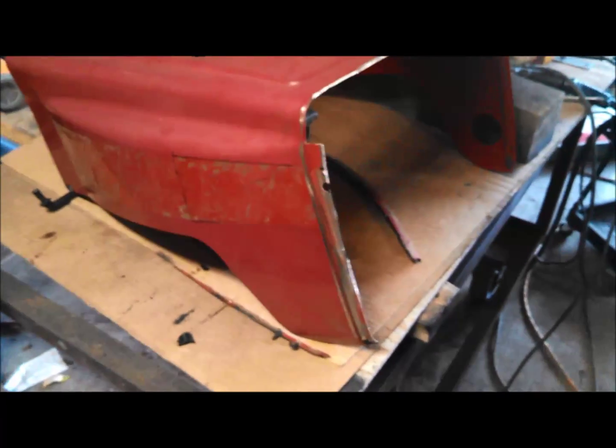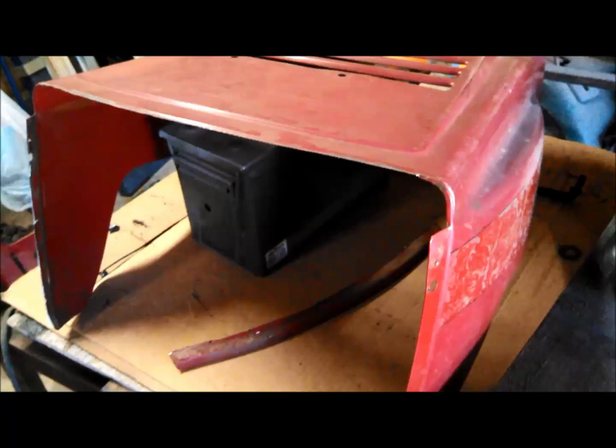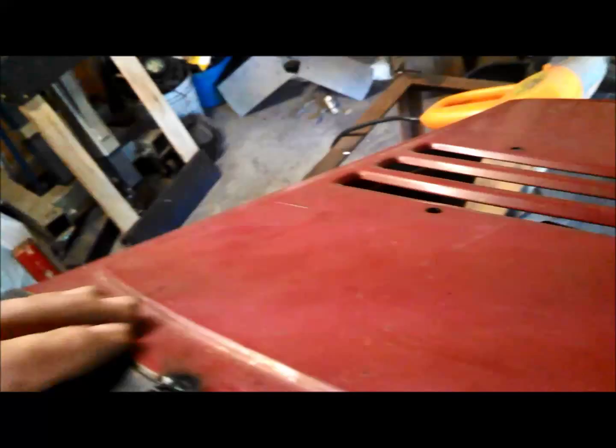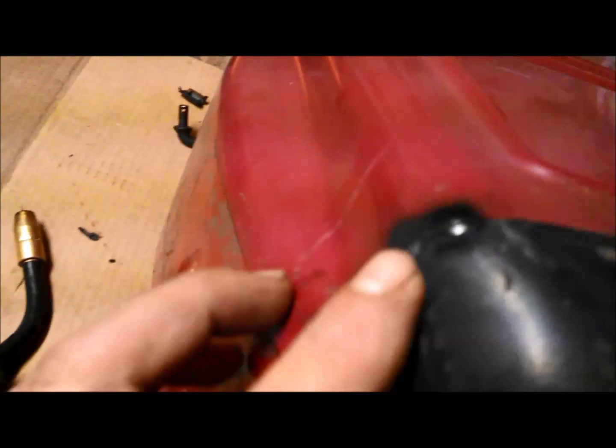There are some lines for some things, but you won't be seeing these videos until a much later date. I kind of want this to be my secret hood. I trimmed everything, I got everything tacked. Most of these outside tacks will come off once I get the inside done. It's pretty smooth already. I am going to have to work it — I had to work this corner with the hammer to get it so it matched up fairly close.